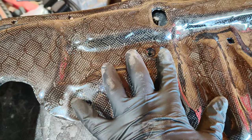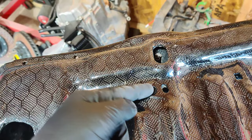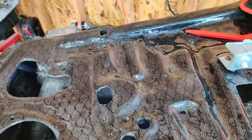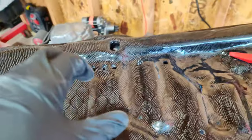I took out the other portion of the window bracket — I believe it sits here and comes up through here. It has M8 bolts or nuts that go here, and there's a piece that goes here too with a bolt through it, but I'm going to have to cut through that because it won't be big enough. Same goes for one of the holes down here because the diameter is different on the carbon fiber door. Let's jump into cutting through this carbon fiber and setting this up — I'm going to put you on a time lapse since it's going to take a little longer.